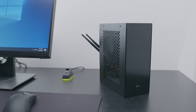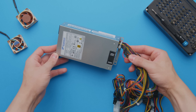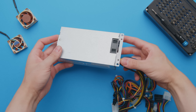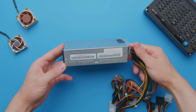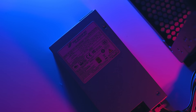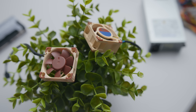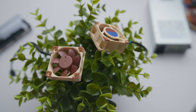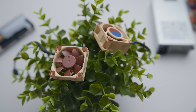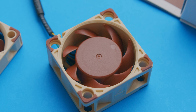The power supply noise was pretty deafening and ruined an otherwise perfect build. The CPU and GPU were running relatively cool and quiet — no issues there at all. So let's go ahead and try swapping that insanely loud fan on the flex ATX power supply. The PSU I've got here is the 400-watt 80 Plus Gold model from FSP. The stock fan is a 40mm fan that's 15mm thick, and I wanted to try both the 10mm and 20mm thick Noctua options at the same diameter.